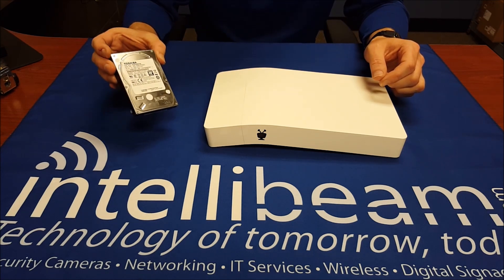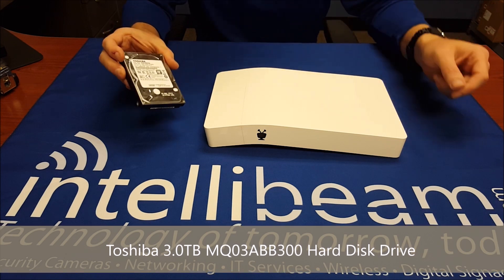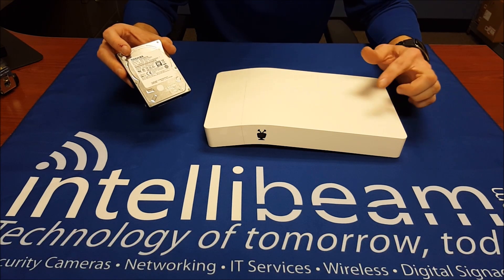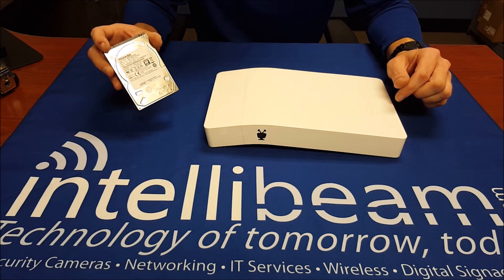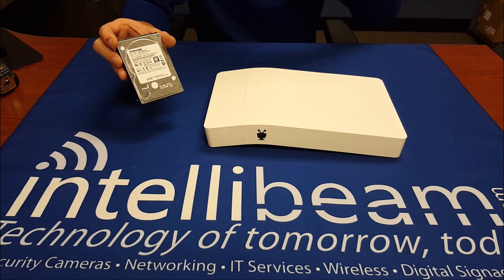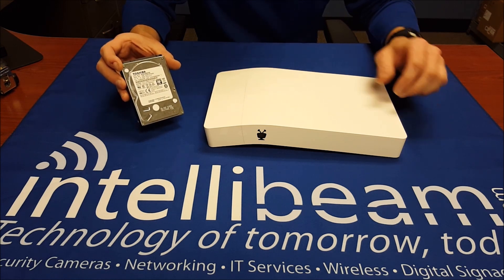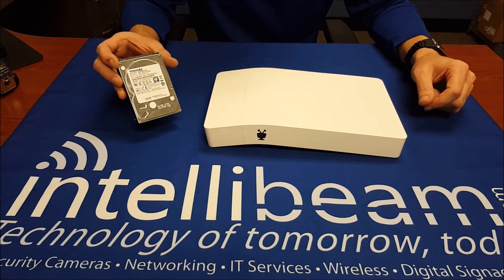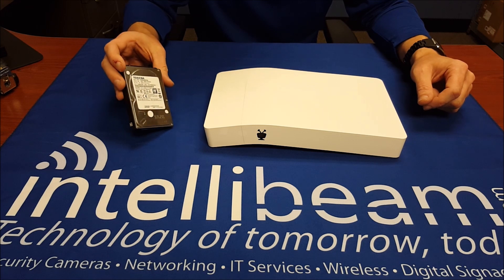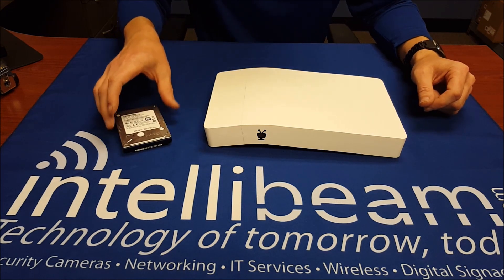The particular one I'm using is a Toshiba 3TB. It's a 15mm thickness which will fit in here. The standard drive in here is 9.5mm I believe. This uses 1.7 watts, the inside uses 1.4, and this particular drive is a PMR drive as opposed to some of the 4TB Seagate ones that use SMR. Nobody really knows if it's going to make a difference in TiVos at this point, but I'm not going to risk losing recordings and one-passes in the future. So I'll just stick with the 3TB instead of the 4TB just to be safe.